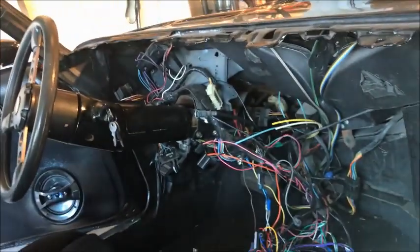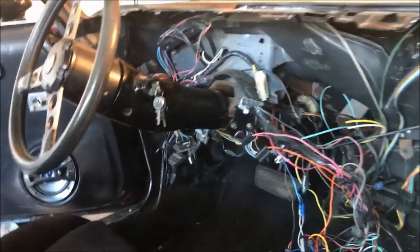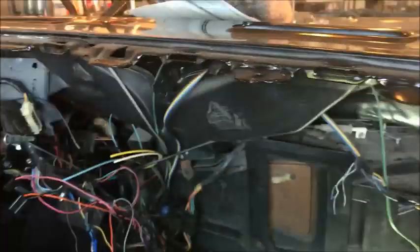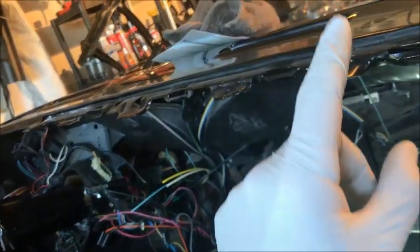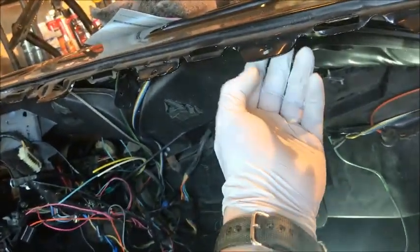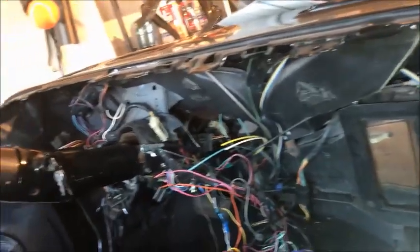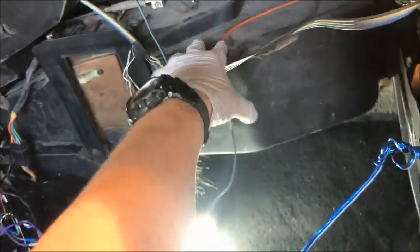The dashboard's out — it was relatively easy. I lowered the steering column with those two nuts. You can see where all the bolts were from the dash. I took off the pillars — there's a screw right in there, take those screws out and pull off the pillar, do the same thing on the other side. Then you go up underneath, take the nuts off, and lift up the dash. It's actually not that hard. The next step is going to be removing the defroster vents and then the heater control box.